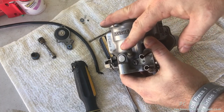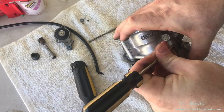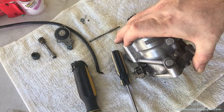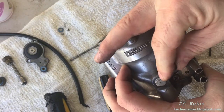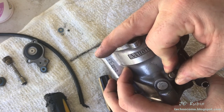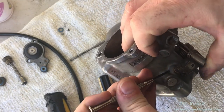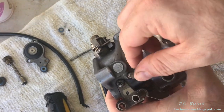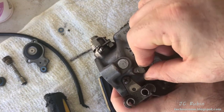I'm going to need to count the turns on this needle to full seat, so I'm going to mark the position on the needle for reference. Count them out — there's one turn, and here's the second line for reference, so it's just under one and a quarter. I'm going to write that down. Now it's safe to remove it. If you heard about the marker disappearing on this carb, I got it on video so for me it's okay — don't write it on your carb.